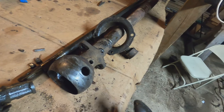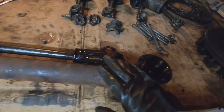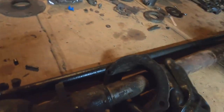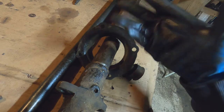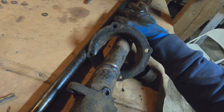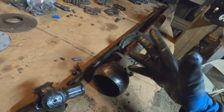So here is the torque tube of the Model T. The Model T has a really unique drive system for the time — really quite advanced. It has this torque tube assembly, which basically is a drive shaft inside of a tube itself that does not rotate. So the car doesn't have a rotating drive shaft underneath it; the drive shaft rotates inside a tube — that's why it's called a torque tube. When you think about the times, this was really advanced for 1908 when the very first Model T was built. So many of those old cars were chain driven with an exposed chain, or they had exposed drive shafts. But the Model T had a torque tube and Henry Ford really believed this was the best way to build it — all the way from 1908 through to 1927 when this car was made.